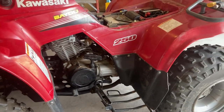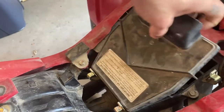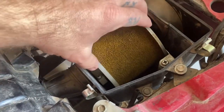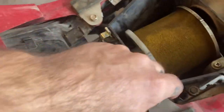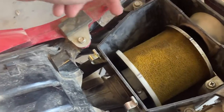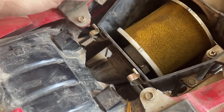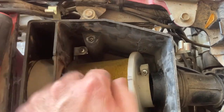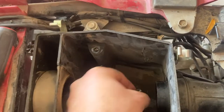I'm going to go ahead and get started on this, starting at the airbox. Pretty simple — this pops right out. Raise it up and throw it off to the side. You've got one Phillips here that'll release this back plate. This will pull up out of a couple bolts — the whole airbox. I think there's three bolts, two on this side and one here, and then a Phillips in the front on the clamp. That'll pull off and you should be able to lift the whole box up out, which then gives you access to pull that carb out. The air filter's really simple — you got one Phillips that you loosen up, and the air filter pulls up and out.